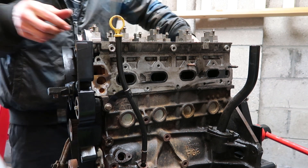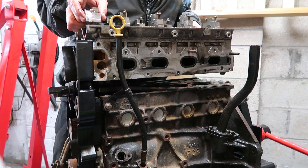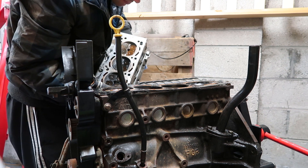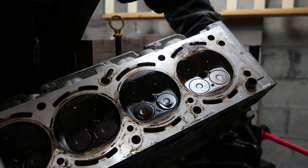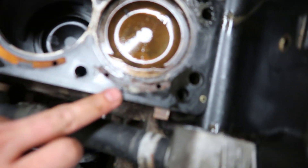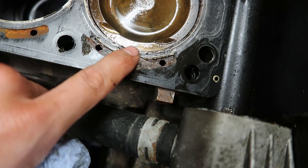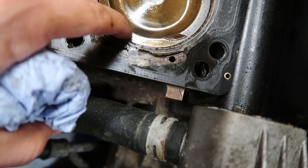It's pretty loose on the dowels. It looks like cylinder one is the one that's leaked through. You can see cylinders two, three, and four are all dark, but cylinder one has got coolant — almost like corrosion on it. You can see the coolant sludge and the gasket has parted here — it popped. Those are the coolant passages or steam pockets out of the gasket, and it's just leaked through into there.